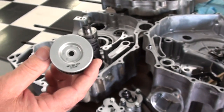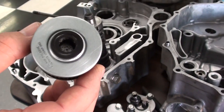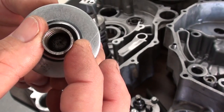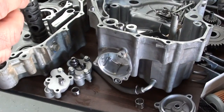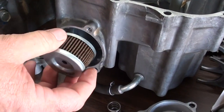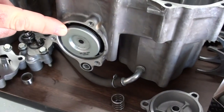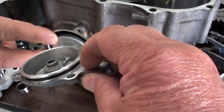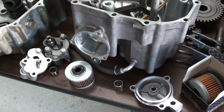As you can see from looking at that thing from the other side, where the rubber grommet would normally fit in the cover, you can see the indentation on it where the spring was up against it. Randy, show them how that filter was stuck in there — that filter was actually in there backwards. When we got it, that's the way it arrived to us. Basically, the cover was fitted up against the back of the filter, which completely stopped the oil flow through it. You can see how easy it was to put that filter in there backwards.